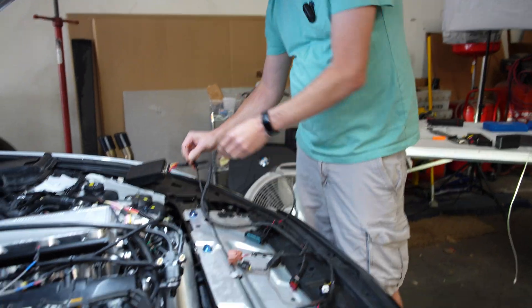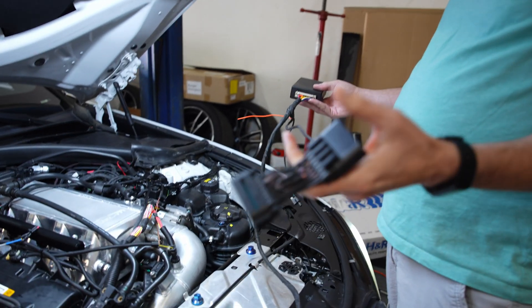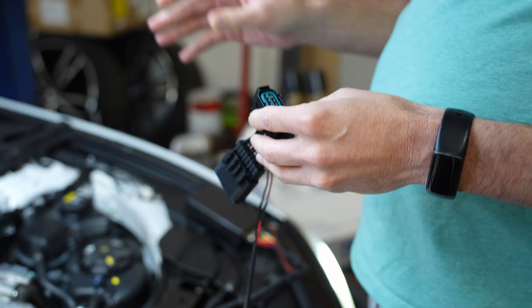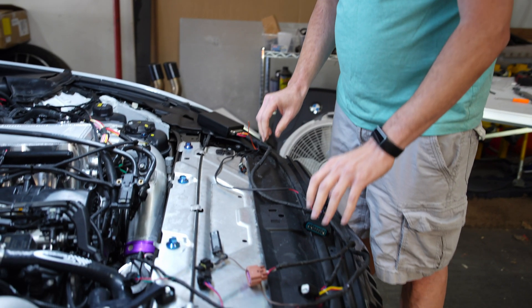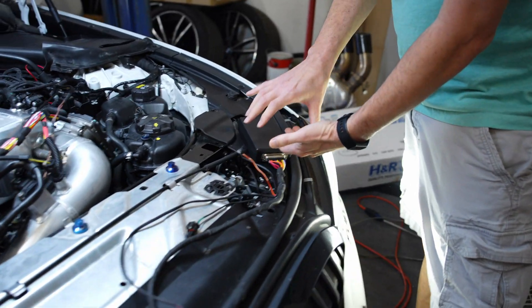There are lots of extra inputs and outputs. There's a low fuel pressure trigger — Steve at Fuel It has some cool B58 low pressure setups in the works, which we plan to put on this car in the next video. The transmission connector is used for power, ground, and CAN bus, so rather than posi-tapping the ECU for CAN bus, it's all in one ready-to-go connector. The whole harness can go on and off the car in five or ten minutes. Note that this is a prototype — the production harness will have nice sleeving, a JB4 aluminum all-weather enclosure, and be fully weatherproof.